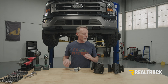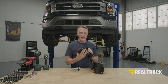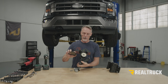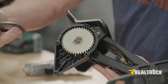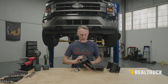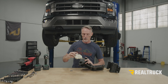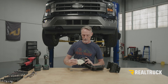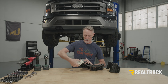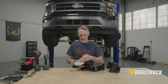Starting off, I want to show you what kind of linkages you're going to have. First we've got our idler linkage — this is just going to stay idle at the back and do whatever the front is doing. Then we have the motor linkage that has a gear attached to it. It's also got a cover; if that falls off, make sure the tab goes back into the slot. What we're going to do with our motor linkage is extend the linkage and then look at the gear on the inside — we want that gear to line up to the gear on the motor. We've also got three holes on that motor housing that line up to the bracket. Make sure the motor is pointing up along with the main portion of the bracket. You might have to wiggle the linkage a little bit to get the gear teeth to line up.